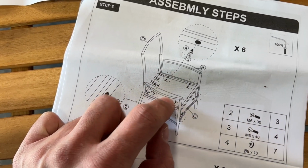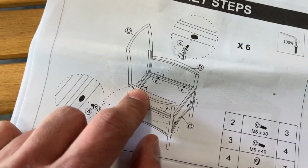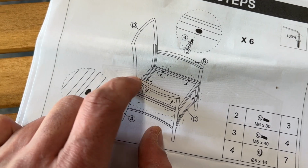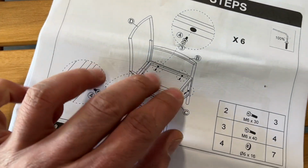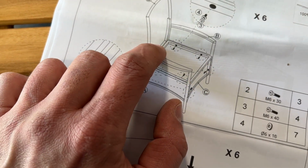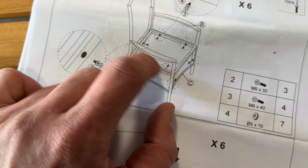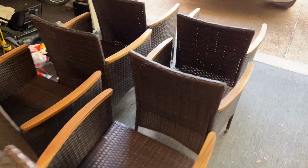And then once you do get those started, don't tighten them. At that point, what I did is go back in this bolt that goes towards the back, tighten that up so it snugs the entire seat bottom to where it should be flush against the backrest. Then tighten these two, and then finally go back and tighten these four. So let me show you the results.